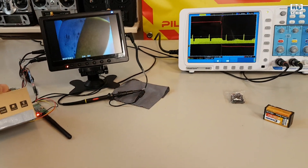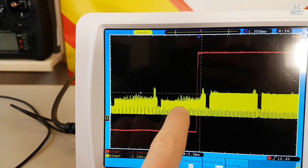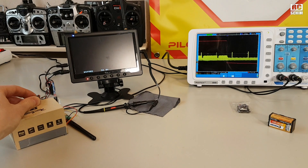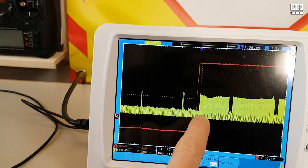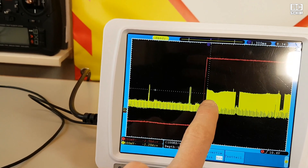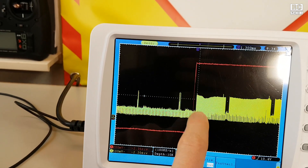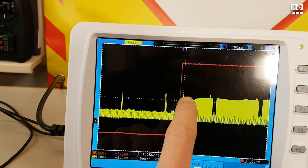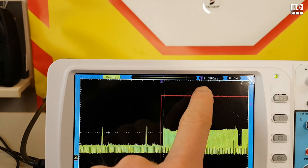I can demonstrate this. Now we have light. Since I opened the box a bit there was some light, so it's only half the height. When the box is closed and turned off, then turned on, you see this change of light, and you always see it at the same time. That's the funny thing — because some cams would take a whole frame to draw the new light levels. But these newer cams instantly switch to full light mode, which makes it really easy to measure their latency. And their latency is almost non-existent.